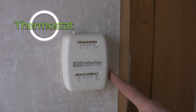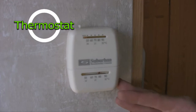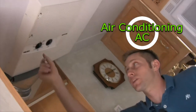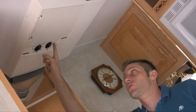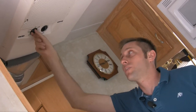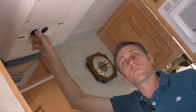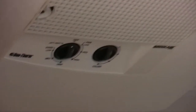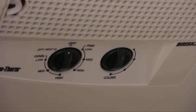Here's the thermostat — this is for your heater only; it doesn't operate the AC unit. Just click it on. This runs off propane, not electricity. Right above is the AC unit — pretty self-explanatory: flip the dials for temperature and fan speed — low, medium, high — or flip it on for actual AC. Something I have to stress: anytime you go to turn the generator on, make sure the AC is off first. A lot of things are already pulling power when you start the generator, and the AC is the heaviest draw. Make sure it's off when you start the generator and everything should be fine.